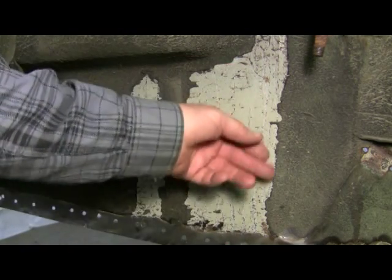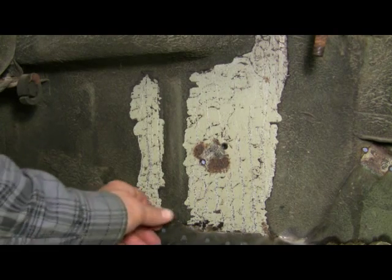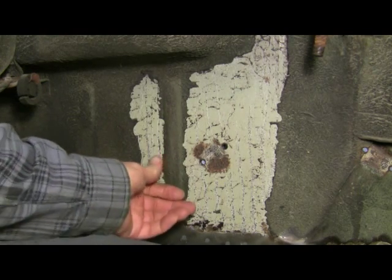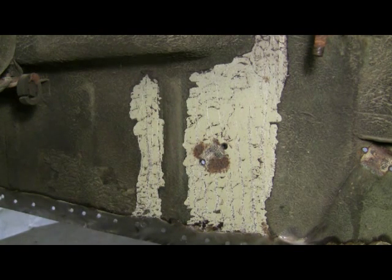Every other method I've tried, it's been hard to get this off. This stuff sticks pretty good, but it separates from the paint very nicely with the air chisel. The only problem is on a ridge like this you can't really keep the chisel on there — once it rotates in the tool it just runs off the side and you can't get the sides either. I'll use the needle scaler or the bead stringer wheel to clean those up, but this car has long flat runs on the underside and I'm going to get the bulk of the undercoating with the air hammer and chisel. I think it'll work out pretty great. I hope this video is of benefit to somebody — thank you for watching.